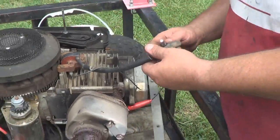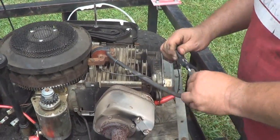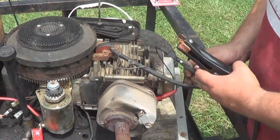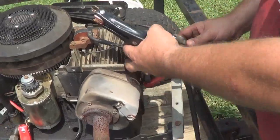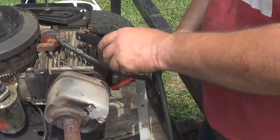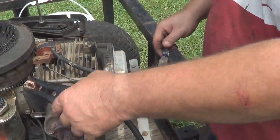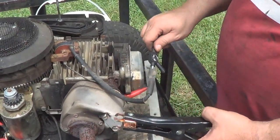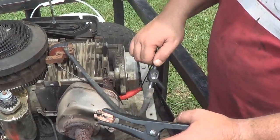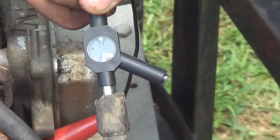Now you're supposed to put your spark plug wire back on. I know this coil is good because we didn't have it running and now the motor will probably start. But I've got to have this wire to kill it. Normally you would put your factory-installed kill wire on it and hook it back up — but remember, you do not put voltage to that wire; it's ground only. So this motor will probably start — watch that window there and watch the spark jump.